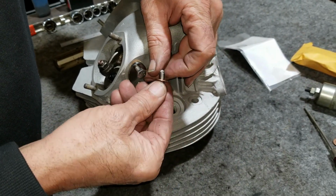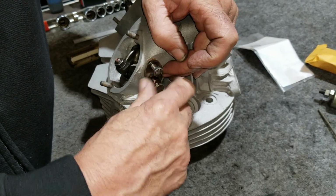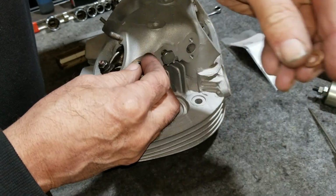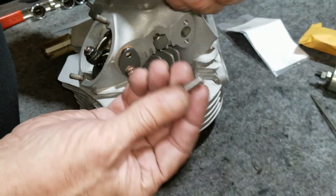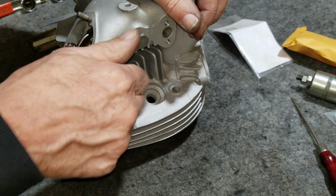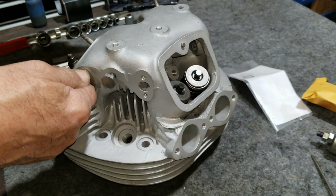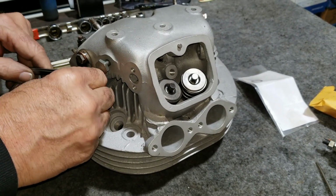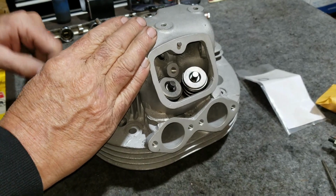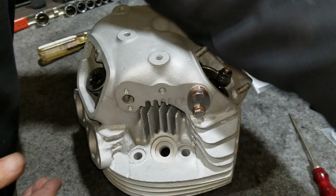Put a copper washer on. I put the rough edge, the sharp edge in, so that the round edge sticks out. You know, it'll work either way, but it looks better this way, because there's a rounded side. If you get in the habit of paying attention, it's just like a regular washer. A lot of times we put the biting edge, that sharp edge, to the inside. Always the finished, curved edge to the outside, just for cosmetic looks and functionality, because it helps kind of like grip. If you get in the habit of paying attention to how you put the washer on, you're always going to have the washers going the same way, most likely. And that's what we really want. That way it looks decent. Okay. Two down. All right, on the intake.